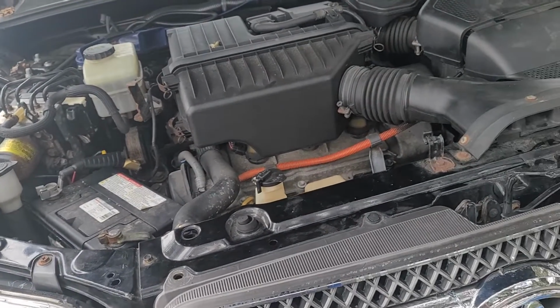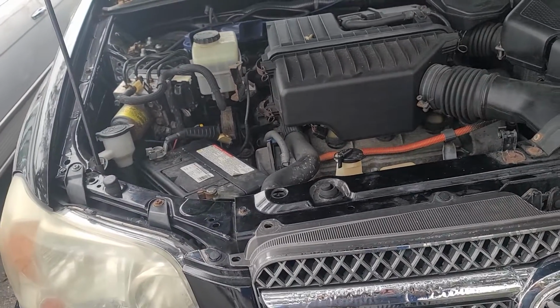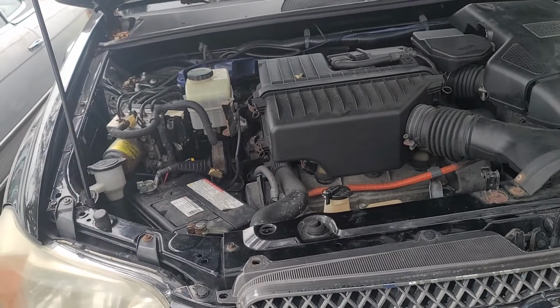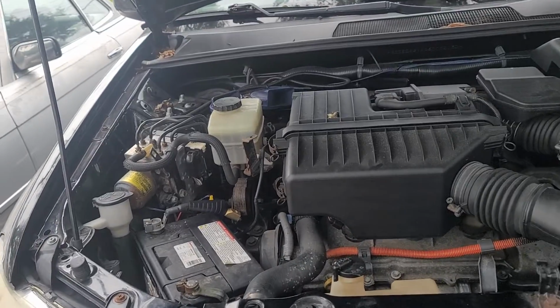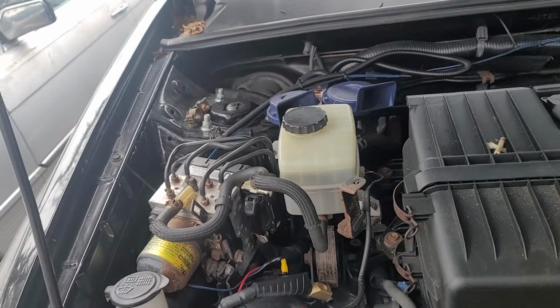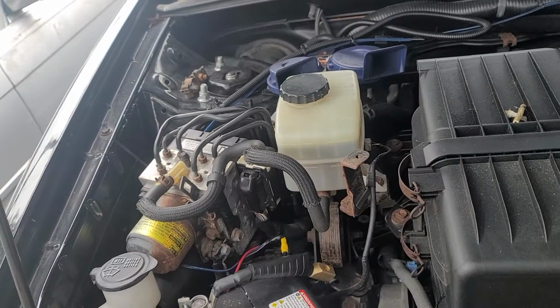So when you have a situation like that, the two places you want to start are looking at fuses, because you could have a maxi fuse or a fusible link that has failed. And you want to check your battery to make sure it's good and your connections. And what we had here was the cable had rotten enough that it fell off the terminal, but it was too short to be reattached.